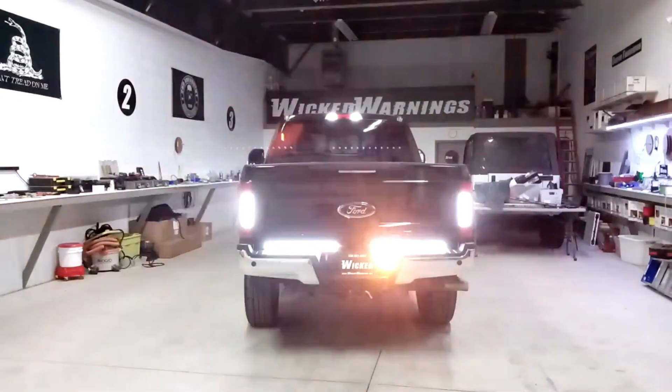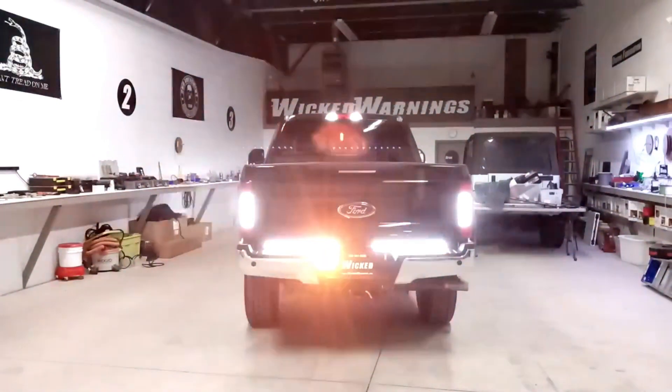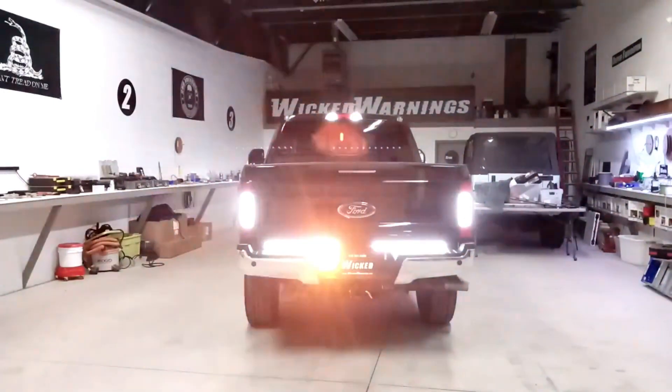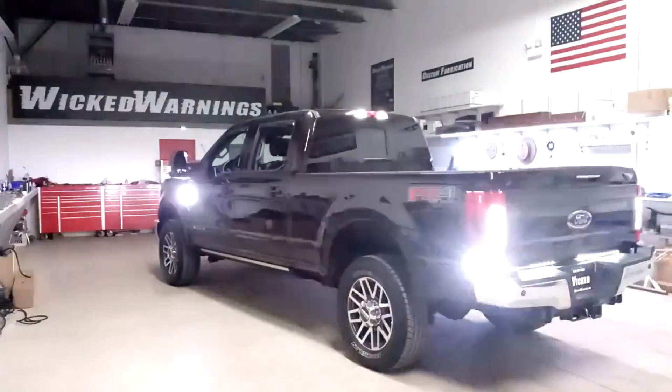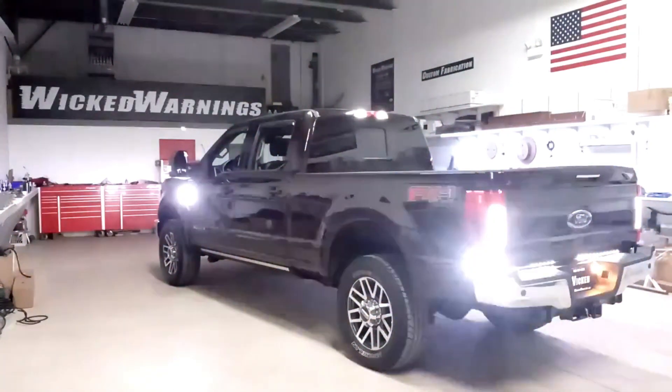In the front, when he activates flood mode he will still have his orange lights on the mirror, the amber mirror parking, as well as the five on the roof. So we've kept the ability to have some warning front and back, and as you can see the side LIN-6s are not affected at all in flood mode. He still maintains his 360 warning with or without flood, and of course if you had the warning off the flood mode will still work without any warning activated. The Thin-X in the badge floods as well as everything else in the rear. The auxiliary switches keep this truck simple: flash all, flood all, and grille flood — ran right off the factory auxiliary switches.